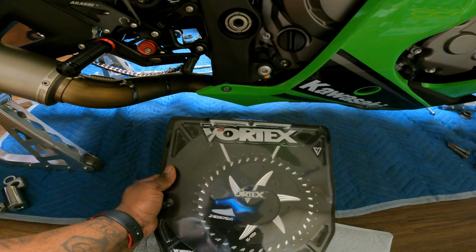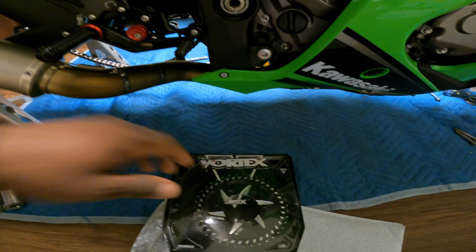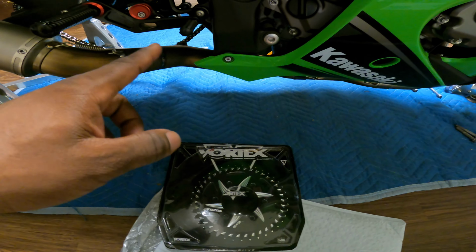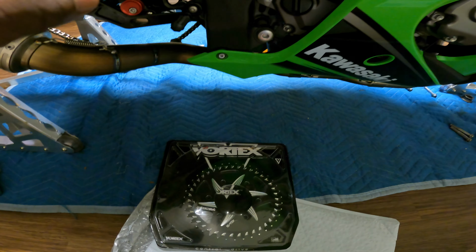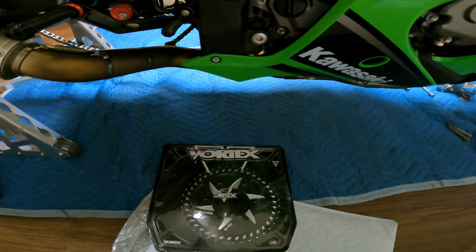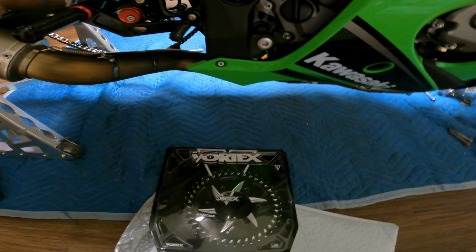But now we're about to switch to a 39-tooth, which shouldn't be as aggressive on the hit, but still should be pretty good, and it should give us a little bit more miles per hour. So with this gearing, we should theoretically make it through the half mile without running out of gear and power. Because now with everything done, Anubis runs through the gear so fast.